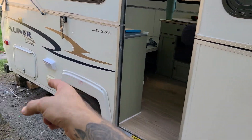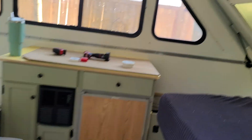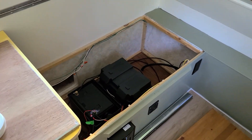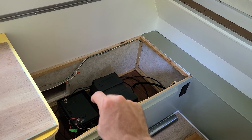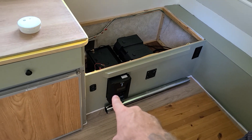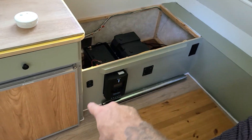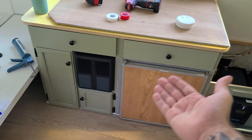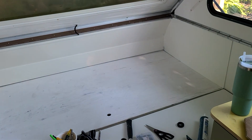All of the painting is done, upgraded all of the lights, fixed all the locks — so all LEDs in here. We got our dual battery back in here; these are two 40 amp-hour lithium-ion batteries. The new stuff is an MPPT solar controller. Wired the whole thing with USBs and new green and black hardware.